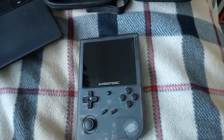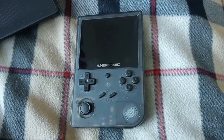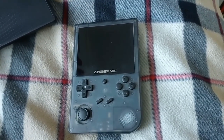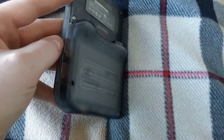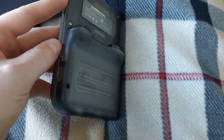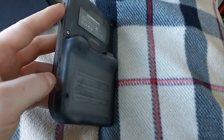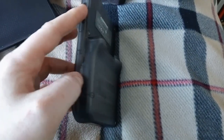I'm going to put two links in the description: the stock firmware, for if you want to put new memory cards in and restore the existing firmware, and the link to AMBER-ELEC. You'll want to buy two cards — get rid of the ones that are in it. The one I've put in is a SanDisk, 64GB. I'd recommend a 64GB one for breathing space. Then there's a 128GB one for the games, which is probably overkill since I'm only using Game Boy Color and Game Boy Advance.